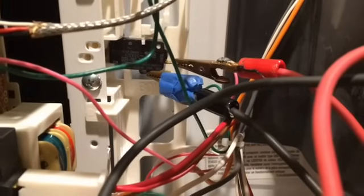There are three switches here — interlock one, primary interlock two, which are controlled by the door when I swing it open and closed. I think one of these has failed. The third is some sort of interlock with a fuse built in.